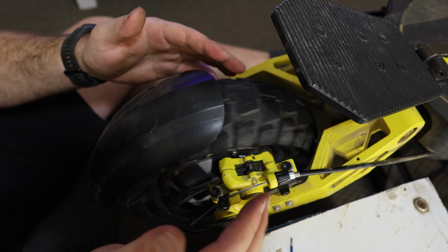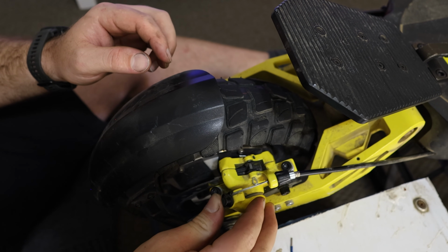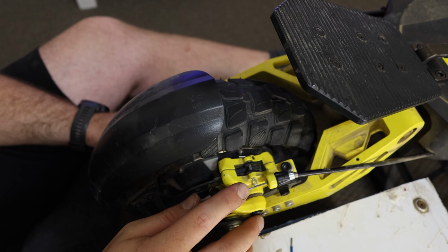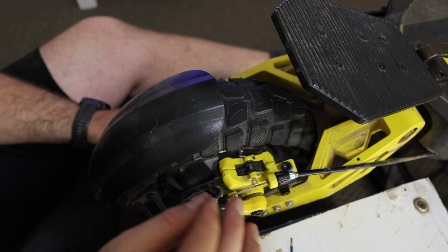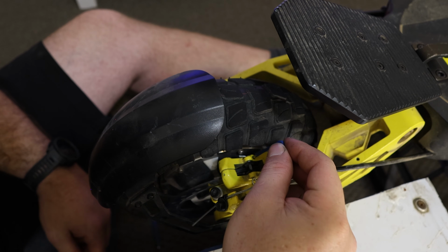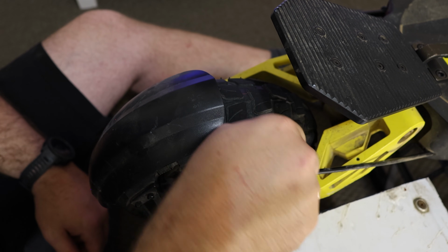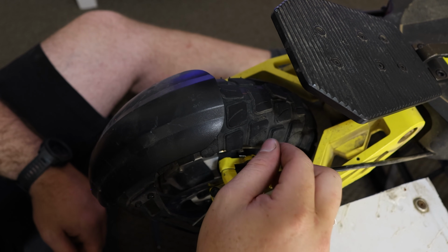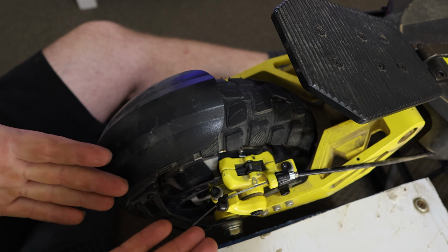And that is perfect. Of course, you can go up to the bars and make that slight bit more adjustment so you can really pull that little bit of slack out. But it is very hard to get the slack out of cable brakes. It is very finicky and it'll take you a long time. If that's the kind of feel that you want, then yeah, you can definitely go all out. And once we have adjusted these guys, remember to lock that Allen key up that's at the top and the back there that's holding that pin from moving, because we have now done. That's pretty much it. We're finished.